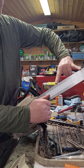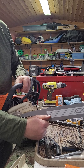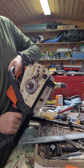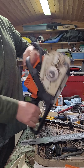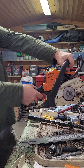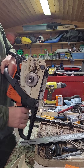If you have to cut with the top, use the section that's well away from the tip. Anytime you strike the tip, the chain is coming around this way and it has the potential to pinch on that portion and kick back toward you. The chain brake idea is that it will instantly stop the chain from spinning if your wrist ends up activating it. When you're cutting, it's always best to have your front arm pretty much locked straight — that keeps the saw out away from your body and helps activate the chain brake in time.